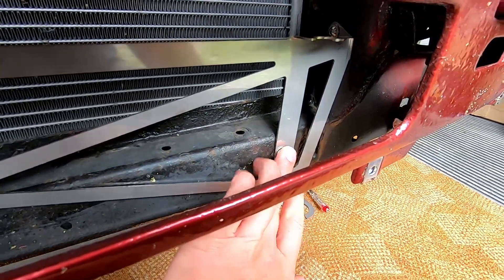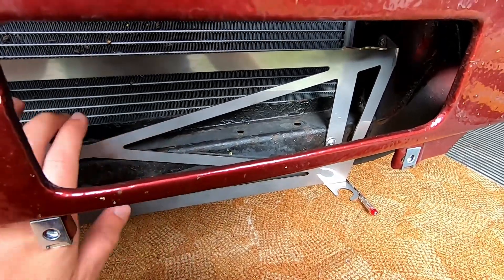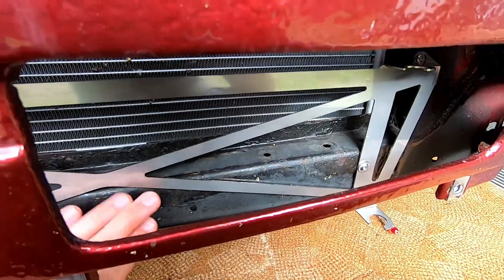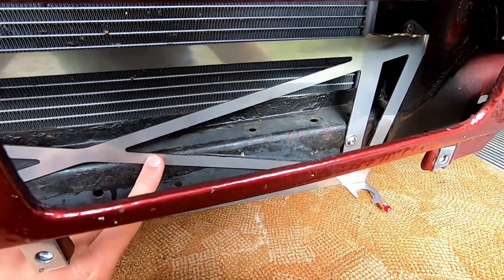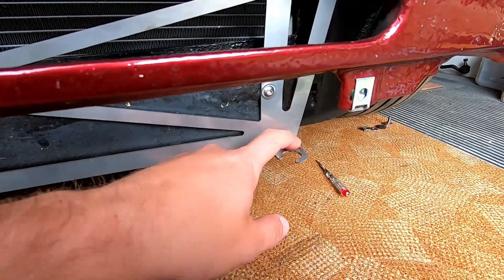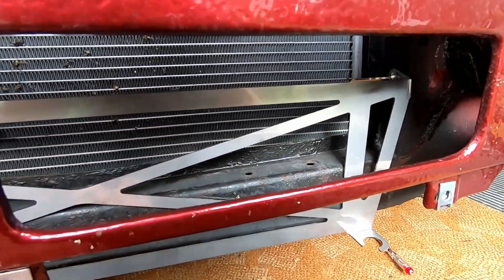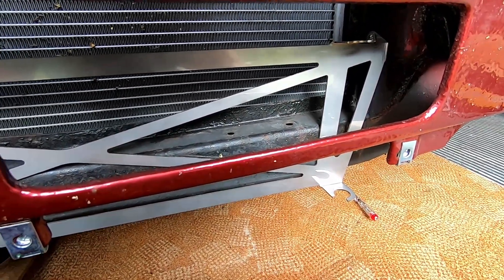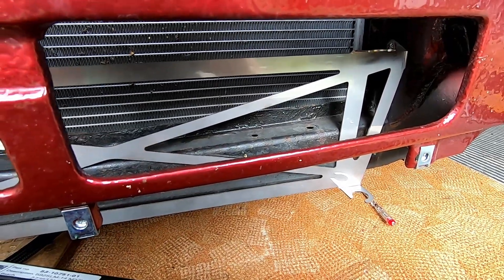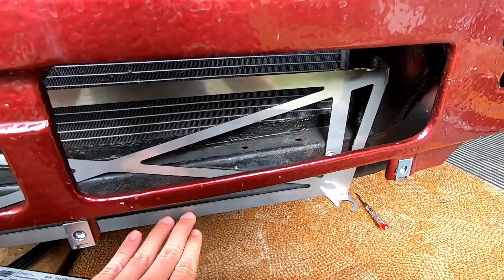The bracket is screwed in place, rivet nuts are all nice and tight. If I were doing this bracket a second time I would skip the cross completely because it's touching a little bit, and I would lower this part and make the bend all the way around on the lower and upper sections. Maybe let me know in the comments if anyone would be interested — I could make an updated version in the future, or you can get inspired by this one.